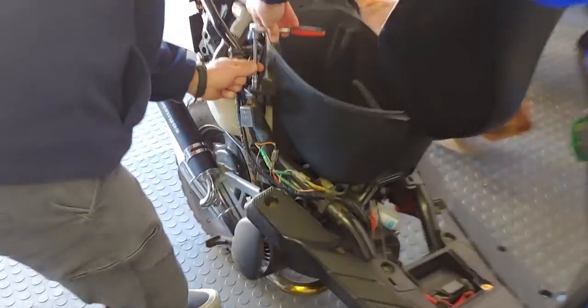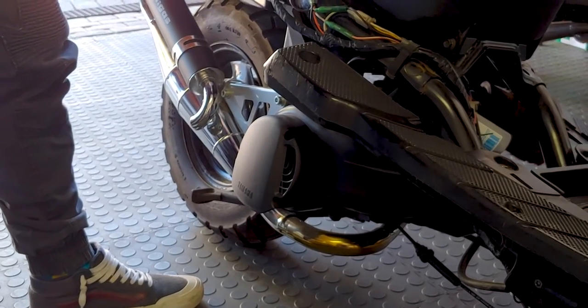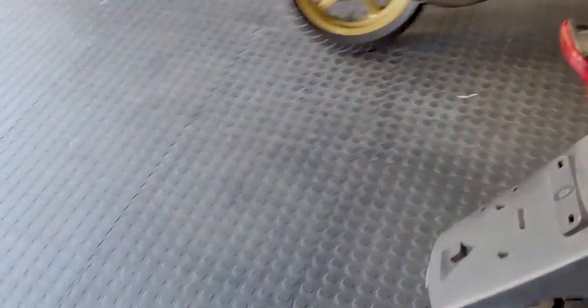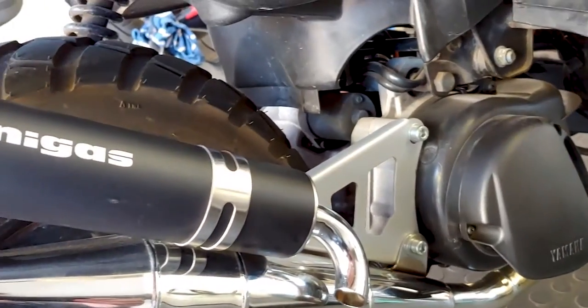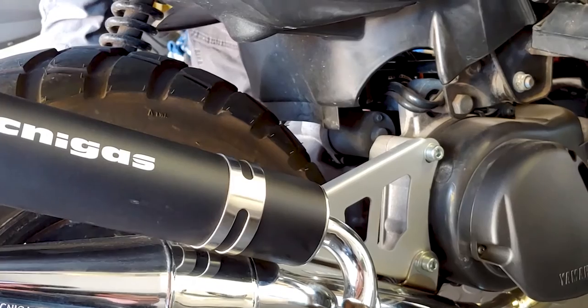All right, so there's Kevin and Kevin's Bws. Today we are going to be replacing the piston and barrel kit, as we've been faffing on this bike for a while because it wasn't performing very well. It was pretty smoky with a fair amount of oil residue on the pipe. We adjusted the two-stroke pump — no change, still poor performance and lots of oiliness. We put it on to pre-mix and same issue, still smoking heavily, which means the rings are buggered.